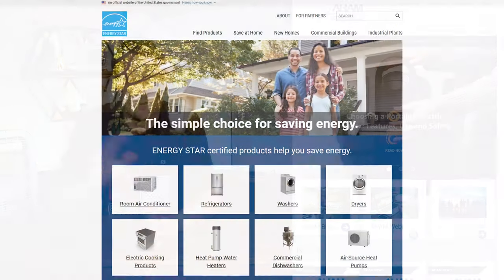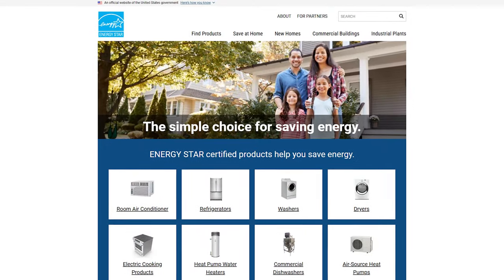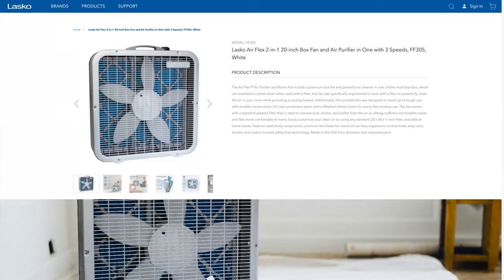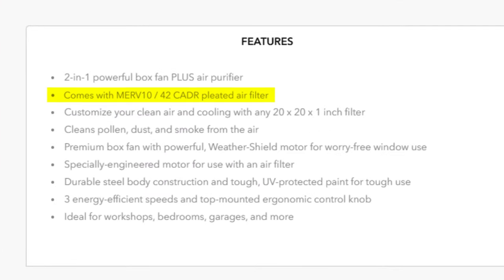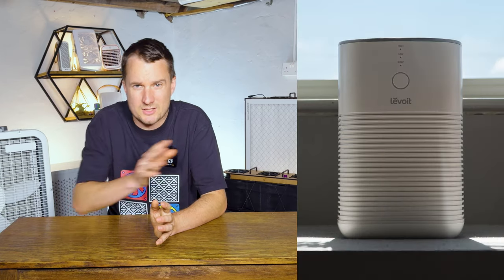The first thing I like to do when reviewing an air purifier is check the Association of Home Appliance Manufacturers or Energy Star website for a CADR report. Sadly there is no CADR report for this device, however Lasko mentions 42 CADR for the MERV 10 filter. If we assume this means 42 CFM, this device would have similar performance to the Levoit Core Mini which cleaned our test room in 113 minutes, or the Levoit LVH128 which cleaned it in 86 minutes.